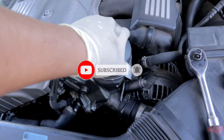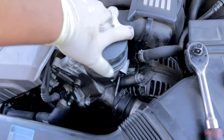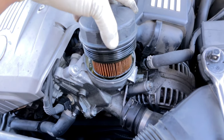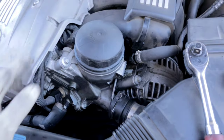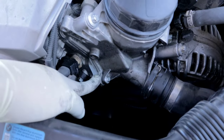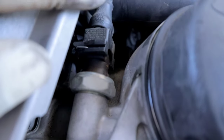Start off by removing the cap here. You don't have to remove it all the way — just loosen it up so that the oil inside goes back into the engine. You'll hear a slight swish of the oil when it goes back in there. You also want to make sure the vehicle is cold so that you can remove some of the coolant, because you're going to remove these three fasteners: this one here, this one on the bottom, and then this other one right there.